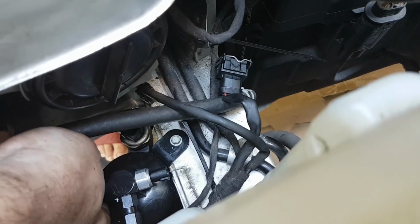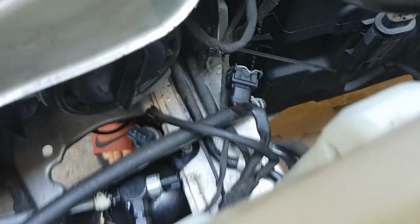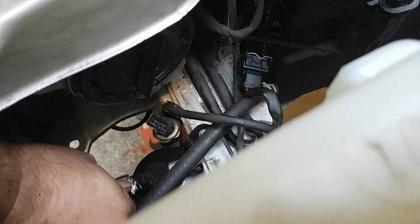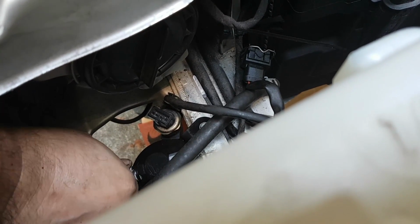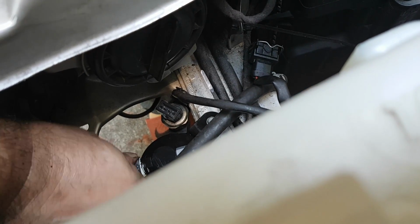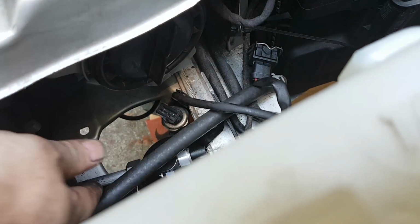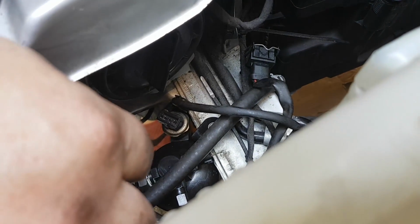I usually apply a little TFE paste I buy from Ace Hardware in the US to all plumbing joints to minimize leaks. And of course you want to rub the rubber gaskets, the two at the end of your pressure lines, with some PAG 46 oil or AC compressor oil.